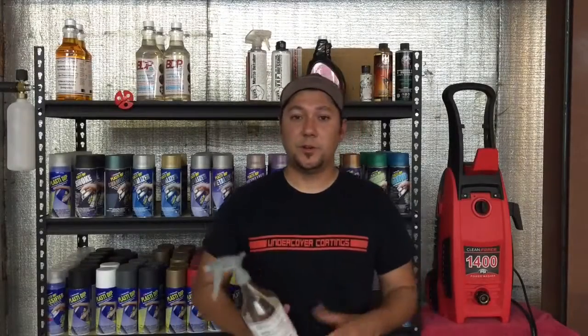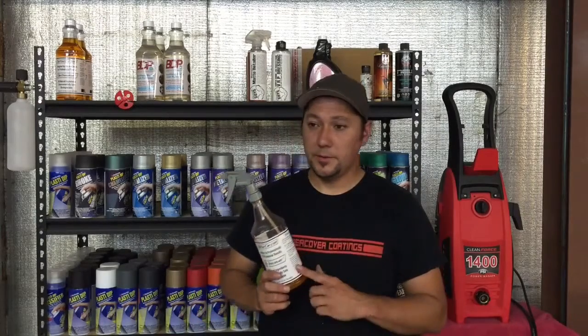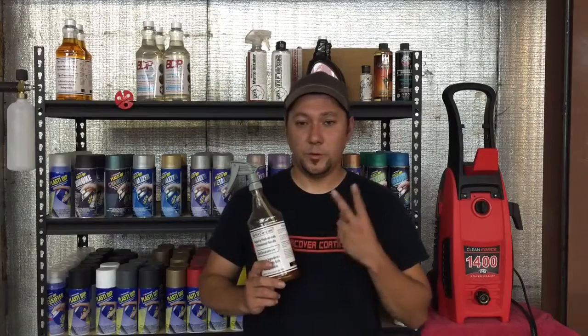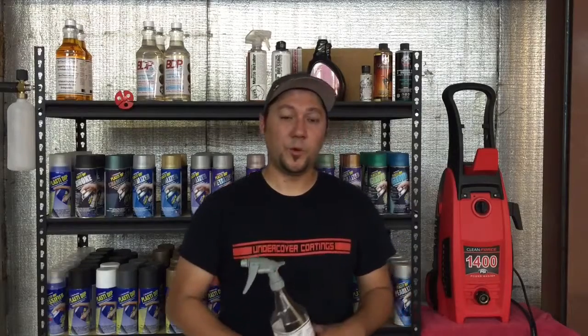Okay, now that you've seen the process, I wanted to close out the video with a little recap and some things to consider. First off, 5 to 10 minutes in between coats. You want to do about 2 coats, and most importantly, you want to test before you move on to the pressure washer. If the dip is not liquefied, it's not going to work, so test it. You may have seen the little zigzags I had in the roof in the time lapse, and that's exactly what that was. I was just testing to make sure the panel was liquefied before I moved on.